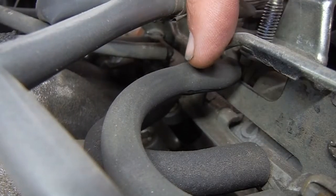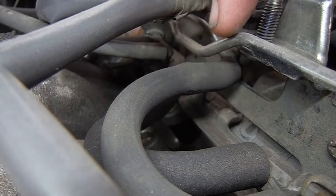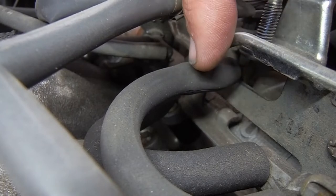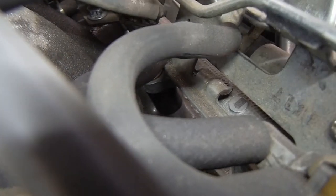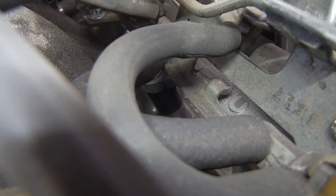After doing this for a little bit, that mineral oil vapor starts to build up and you can see it's actually starting to turn kind of dark around that crack. I'm going to give it a little bit more smoke so that shows up for you. There's the leak — pretty easy fix, obviously just going to get a new piece of hose and throw it on there.